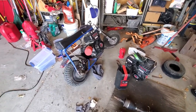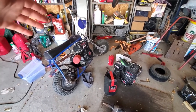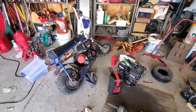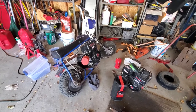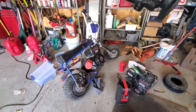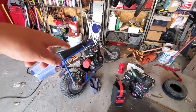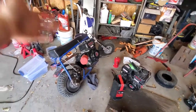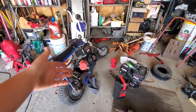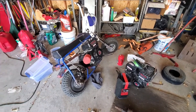The flywheel was slightly rusty, not too bad at all. The magneto was pretty clean but had dirt all over it — I cleaned that all up and reset the gap. It was a super super tight gap. I've seen a lot of people building these engines say to run a looser gap on your stock flywheel, and then when you get to the billet ones with rare earth magnets, run a tighter gap — or actually the exact same gap with that strong magnet.